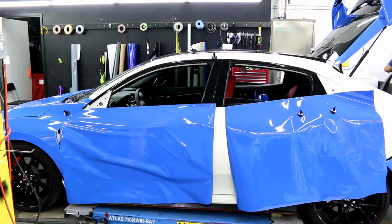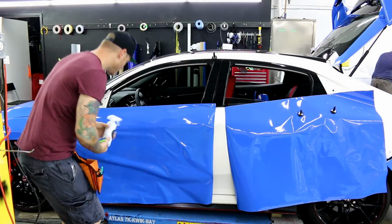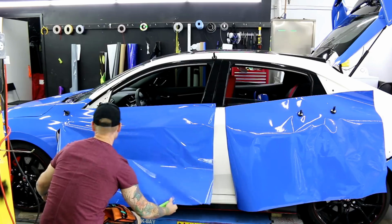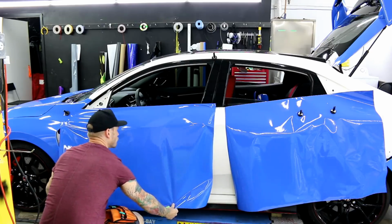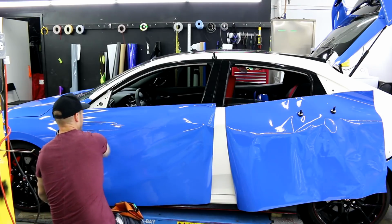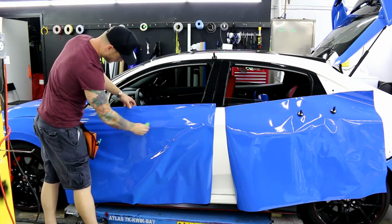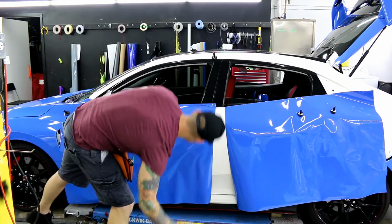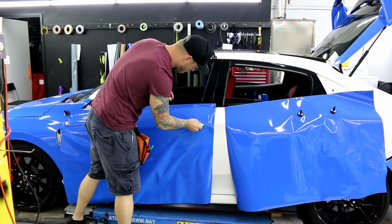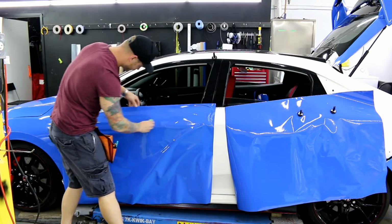I'm just going to grab some Shield Guard, because this is going to help my squeegee glide. Again, in the description below, this is going to help my squeegee and the buffer glide along the edge. Okay. So I want to find a hard body line, which is right here. Perfect. Before I do anything, I'm going to come up with the film so I can lock in the top section. This way I don't get any dirt or contaminants falling in from the top. Not that there should be, but again, it's possible.